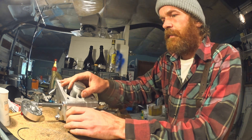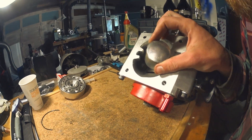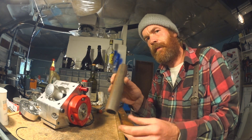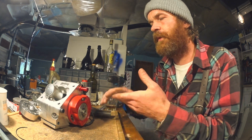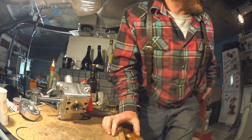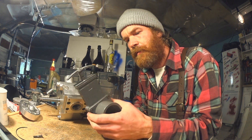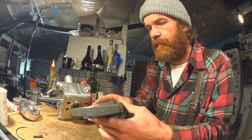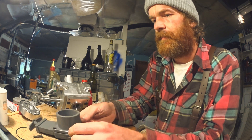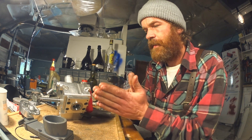It might be too low — there might be too much volume in here. The reason I've gone for that much volume is because it's kind of difficult to determine where that intake pipe stops and where the case starts when it's open. There will be a thin slide valve here. Here's my temporary solution — I might actually try running it with this PVC valve, because PVC is resistant to gasoline, methanol, and nitromethane. What's nice about this valve is it has rubber seals that seal well, so when it's closed it is closed and it seals. I'm not quite sure if it will seal well enough with just a thin steel valve and aluminium.